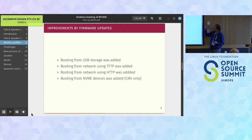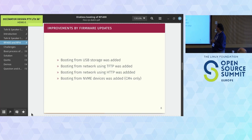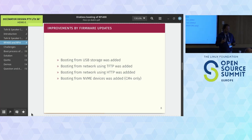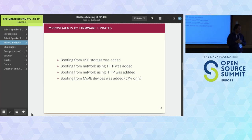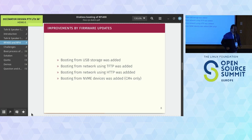The Raspberry Pi Foundation found that SD cards were not ideal and improved things. The Pi 4 has its own boot EEPROM with a bootloader that can be upgraded fairly easily. Gradually, booting from USB mass storage was added, and then booting from the network using TFTP was added - which is what we're going to focus on in this talk.